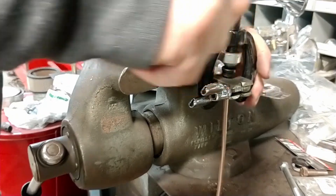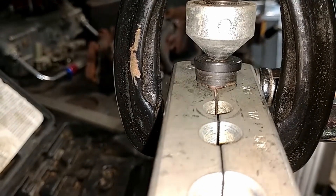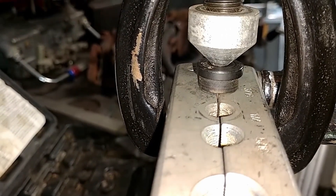If you've been paying attention, you've probably noticed that I have not lubed the end of this tube in any way, shape, or form. I'm only able to do that because I'm using copper-nickel tube — that stuff's pretty forgiving, especially with the smaller sizes. If I was doing a bigger size tube, even of that material, I would probably lube it up. You definitely have to lube if you're talking about a steel or stainless line, because those have a high tendency to split out without lube. For brake line scenarios, keep in mind that a lot of stuff is not compatible with brake fluid, so really the only thing you can use to lube a brake line is some brake fluid. It doesn't take much to tighten it up. All you really have to do is watch your anvil and when it comes down and contacts the flaring bar, we're done with the first part of our double flare.